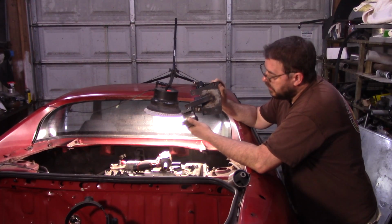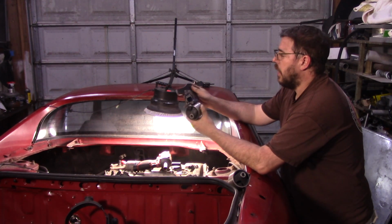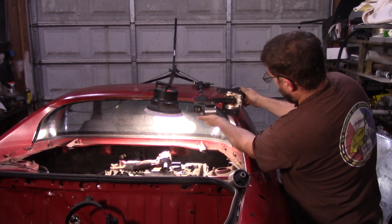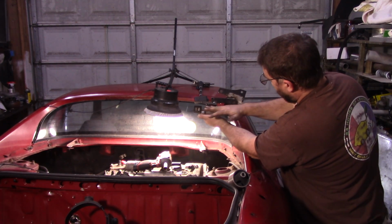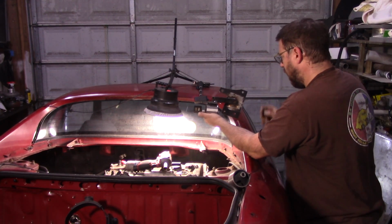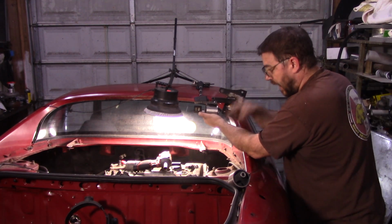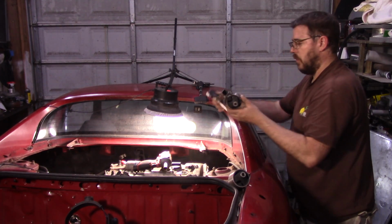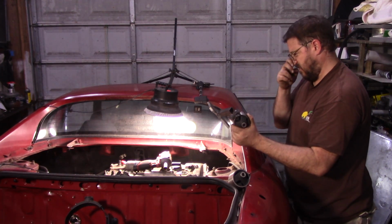And there it is. In 3D space, we have everything located. So I just need to pick up these points, and interestingly, I guess it probably makes sense, the straight here, which is straight on the chassis, ends up being about straight across these mounts. So that's probably because the angle's mounted at the right position. Either way, we're not going to change the angle because it's set by those other mounts. All right, so all I got to do is pick up all of these points and design a mount.